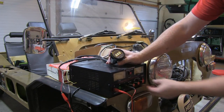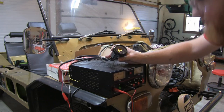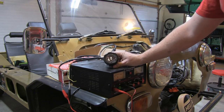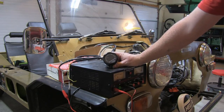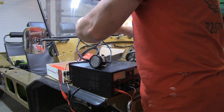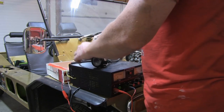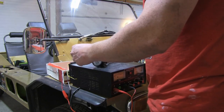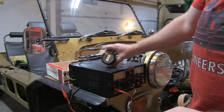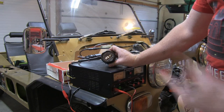Power it. Voltage is right. Okay. Displays E2. Power it down. Connected to the sensor, pull that cap off. Power it on again. Look through the heater cycle. Still heater.